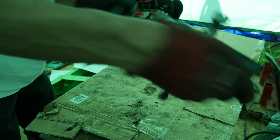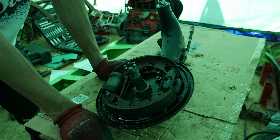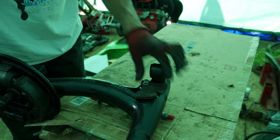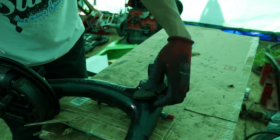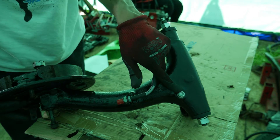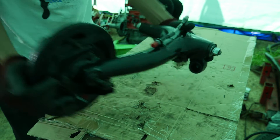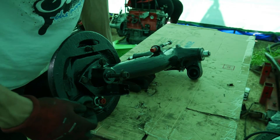I covered the handbrake lever arm in copper slip just to keep it well lubricated in case it starts to get a bit gritty, and then you can fit it to the handbrake. I fitted the handbrake quadrant — that was really easy. I bought the kit to replace the cotter pins so now I've got a bolt instead. Then I've put these Goodridge brake lines on, and now I'll show you how to fit the new copper line and shape it off the old one.